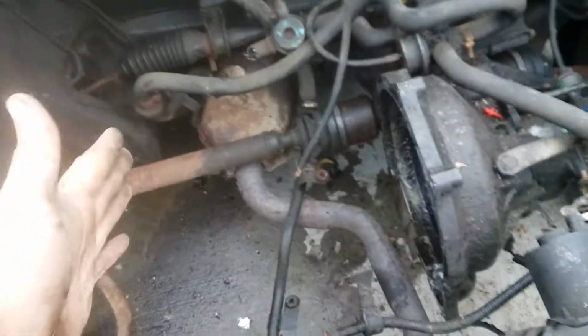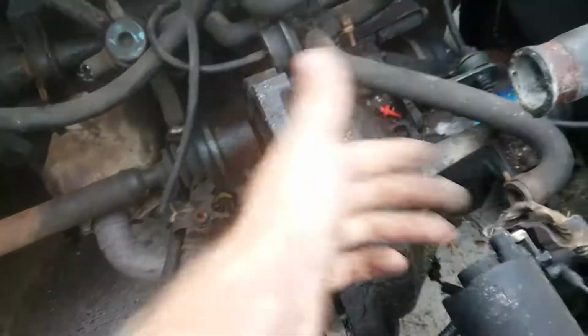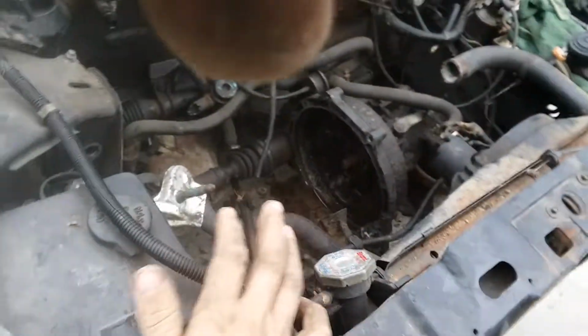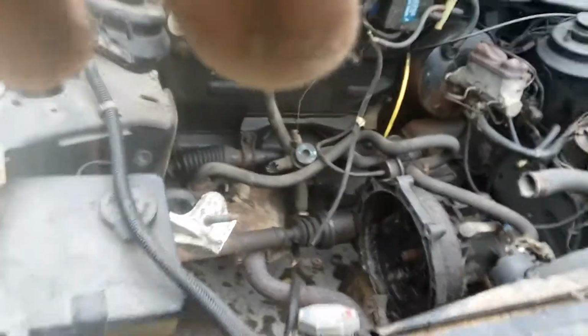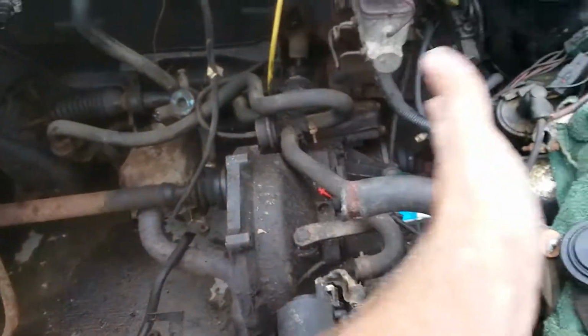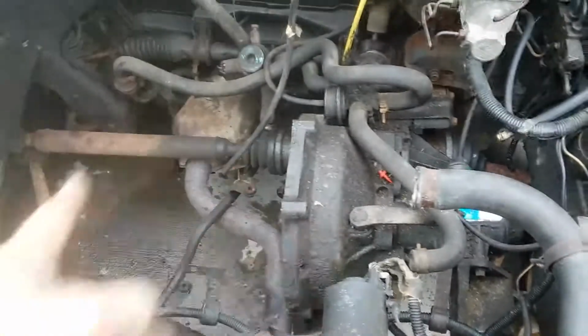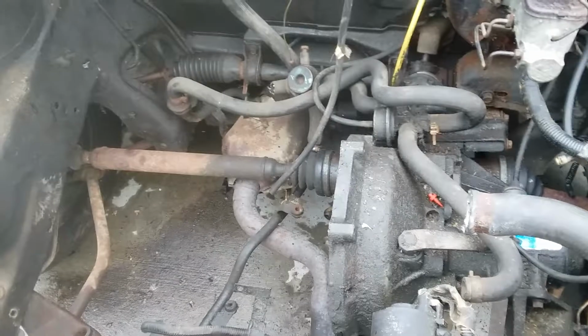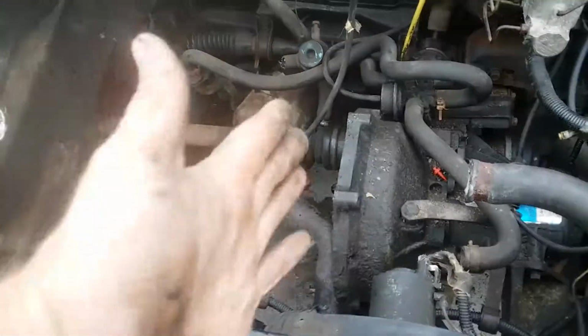Now you can slide the engine over, and with your tranny already slid over to the side, you get 3 to 4 inches here, which is plenty. That's more than enough. So then you can bring the entire engine out the top without any more hassle than what you already had. But now I know in the future that if I don't have that hole, I just have to slide the tranny over, leave it attached to the motor at that time, so then they move together as a group a little bit easier. And then once you get the pulley off, separate the two, engine comes out, and you're done.